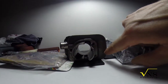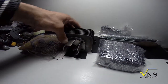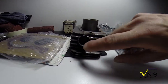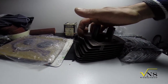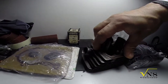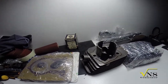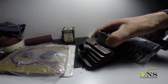There's actually a little bit of dust because it was in the workshop for machining, for the boring. Here you can see the quite large exhaust port — I think it's the maximum you can reach. Here, something was added with welding because the material is so thin here that I preferred to add and then remove, to be sure that everything was okay with the exhaust for the sealing.